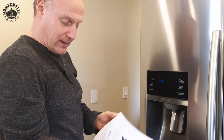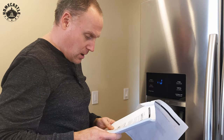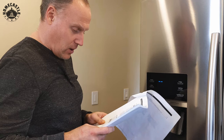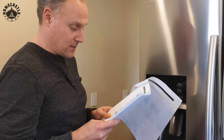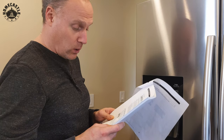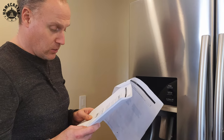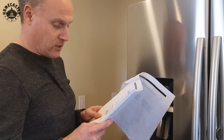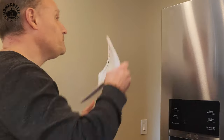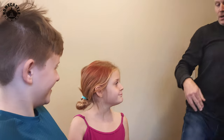The manual says: to cancel test mode during simultaneous defrosting of fresh food and freezer compartments, if the display panel changed to test mode and the test button is pressed one more time, defrosting will be canceled and the unit will return to normal operation, or all test functions will be canceled by turning main power on and off. I'm going to turn the main power on and off.